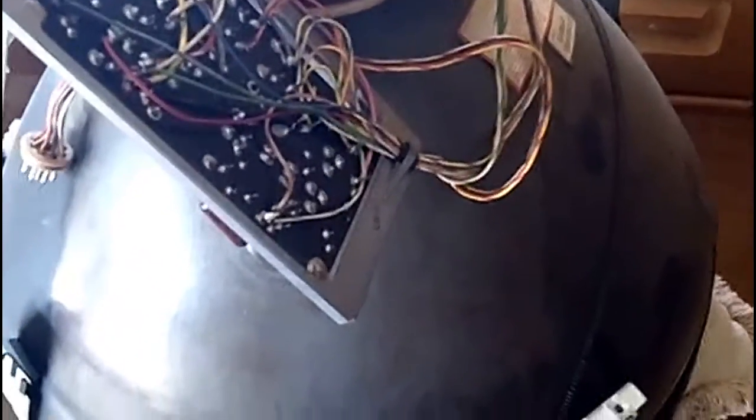What I'm discussing here is the correct setup of the components on the neck of a CRT — in this case a color CRT. One of the first things you want to start off with is making sure the CRT is oriented right in the set. There's a little molded-in spot in the glass at the top of the CRT that should correlate to a hole in the mounting band. This ensures the riveted mounts put the CRT straight up and down. When oriented properly, the blue convergence coil will be at the very top.